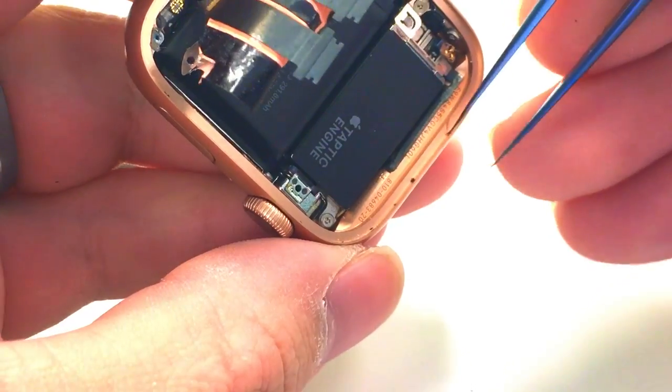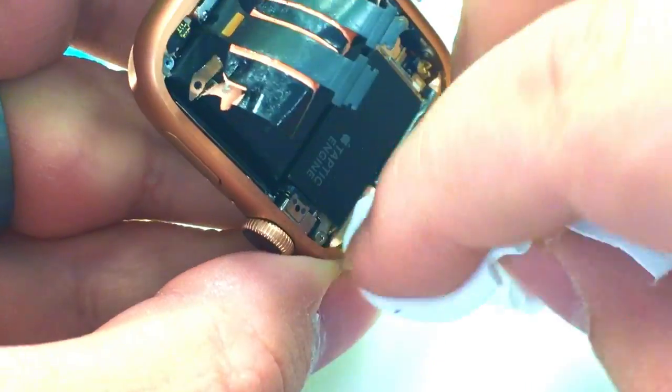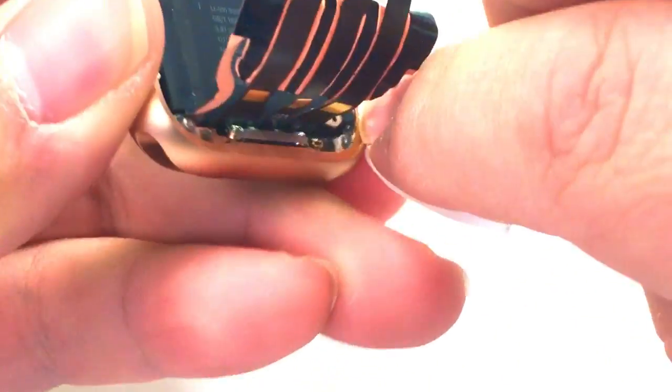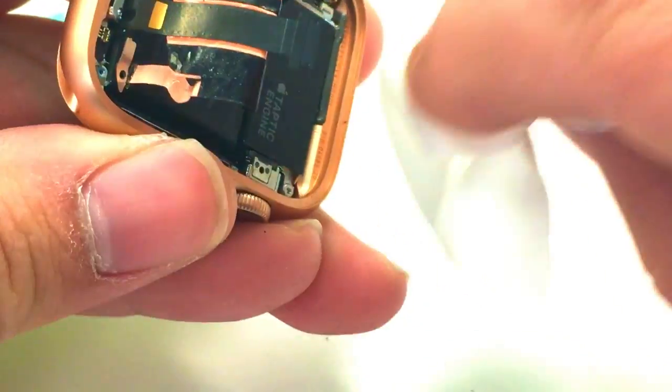As you can see there is a little bit of debris that we are going to want to remove around the frame so that we can get a good clean surface to adhere the new force touch sensor to, and also get as best a seal as we can for water resistance as we finish up the watch. I'm using a clean room wipe with a little bit of acetone, just being gentle not to touch anything but the frame, to remove any debris, any dust, any old adhesive — anything that would prevent an uneven surface.